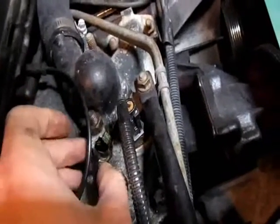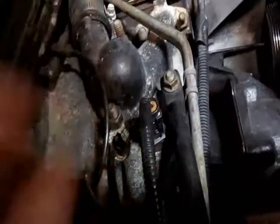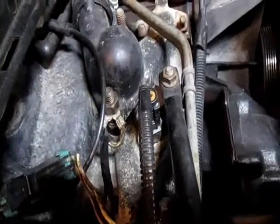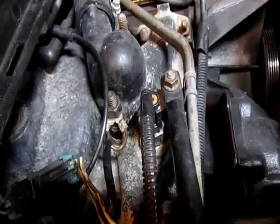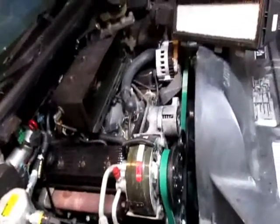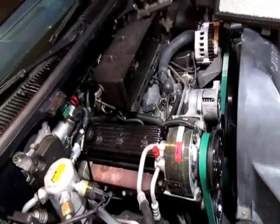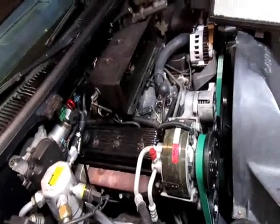I think the ground is bad. I do have better connectors — like a GM eyelet instead of these crappy ones — ones that support the wire and support the bare copper, so I should really find those and install that to rule that out as well. It does smell more gassy than my truck does. It's hard to say — the heat soak, that's what it is. If the engine does not get super hot underneath the hood, it will not stall.